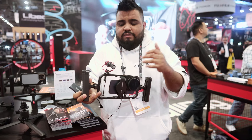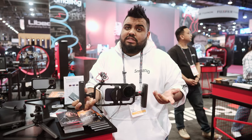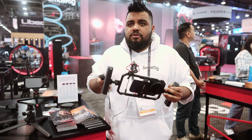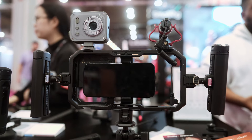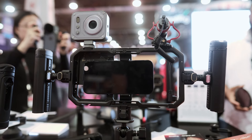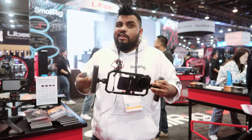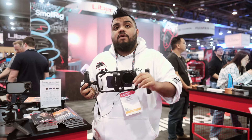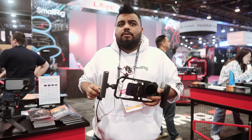If you want to go for the full build — audio, storage, external power — you'll need a hub. Something like the Belkin hub is a lot more compatible. There are multiple hub systems out there, but you have to do your due diligence and check which works best. We had a customer we spent a whole month trying to find a hub for because he was going for cheaper Amazon options, which are more designed for computers rather than mobile in-and-out data transfer. The Belkin hub, which we have on display at B&H, actually works well — but stay on the lookout because we might be looking to produce our own hub pretty soon.